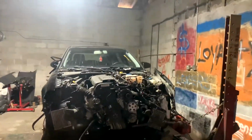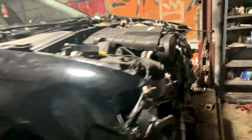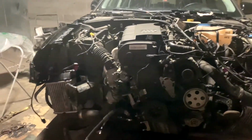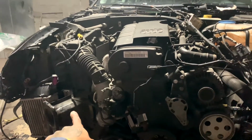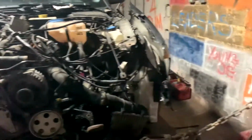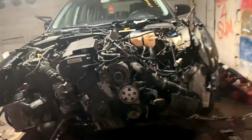Welcome back. I got it strapped down, did a few measurements or whatnot. So, of course, this side got to go over that way, but it's still kind of leveled. So pretty much all I got to do, I'm going to take my torch, heat it up, start on this side first, get it pulled out, do another measurement, come on this side, heat it up, pull it, do a measurement, see where I'm at.